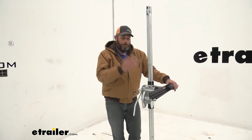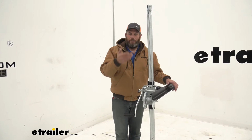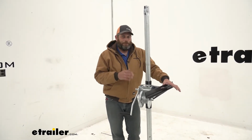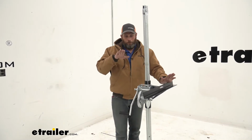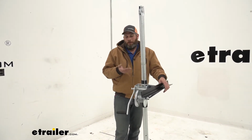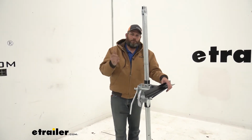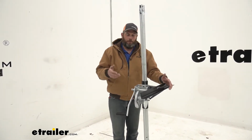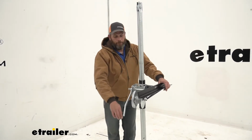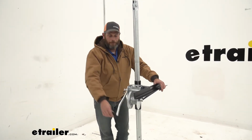But it's not necessary. You can move one up 6 inches, go to the other side, move it up 6 inches. Basically, we don't have to lift a truck camper very far. Your suspension's going to be pressed down, so you have to get past that suspension movement. But you just need a couple inches. Once you've got a couple inches, disconnect your plug and just pull your truck out. At that point, we're going to start lowering it down.